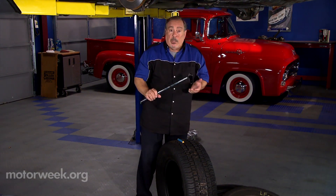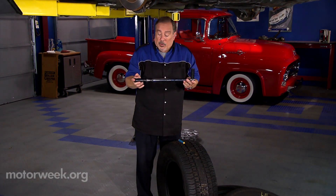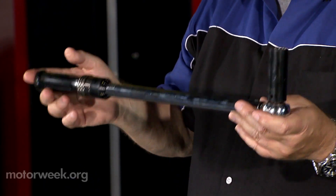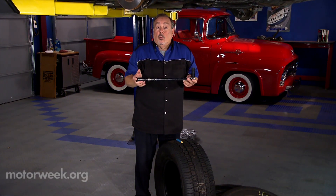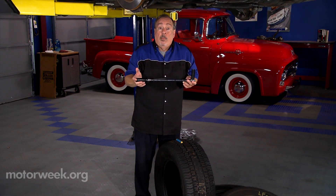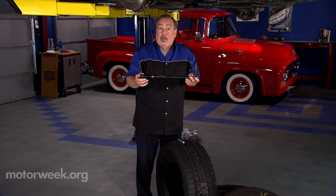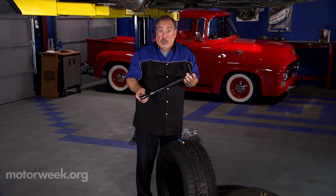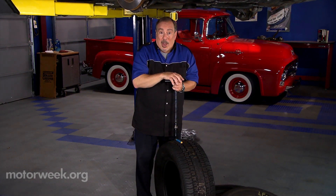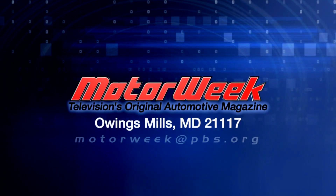The second thing — and this is especially true if you take your car to a repair shop — always use a torque wrench to reinstall the wheels. Torque wrenches will prevent warped brake rotors; air impact wrenches almost guarantee warped brake rotors. This can save you a lot of time, money, and aggravation, just like tire rotation can give you a lot longer tire life. If you have a question or comment, drop me a line right here at Motor Week.